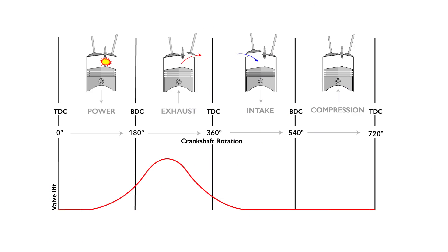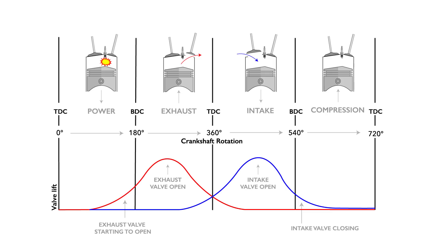The first thing we'll do is get the cylinder head, the parts, the engine and start to reverse engineer and measure the factory valve lift curve. In this particular engine there's a compound rocker arm system for the variable valve lift system. So we'll set up our cam measuring software and actually bolt it to the head rather than to the cam, and measure the valve lift curve of the stock cams. Then we'll measure the cams themselves, and the tricky part comes in interpreting the geometry data to get those two curves to be the same thing.